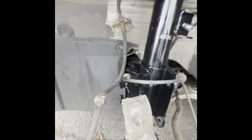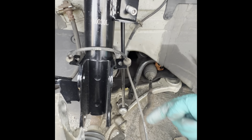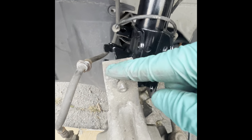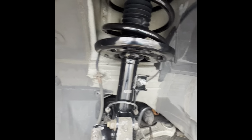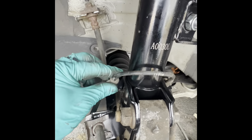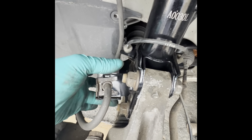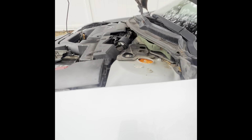Get them snug first and then start working on the lower section. Don't forget we have to come back and make the top bolts tight. Over here, put the nut on, secure the grommets for the wheel speed sensor, insert and line up the lower bolts, then put the brake line where it goes. Everything is back the way it was — brake line clip installed, grommets installed and routed exactly how they were before, the two lower bolts nice and tight, the sway bar link tight, and the three top bolts nice and tight.